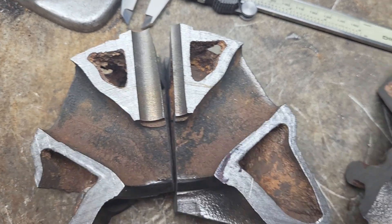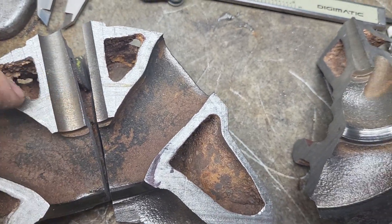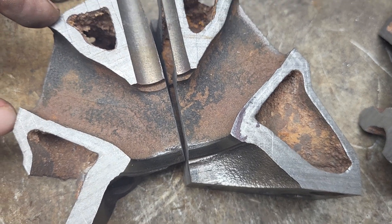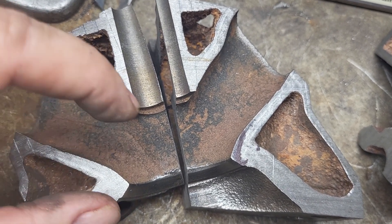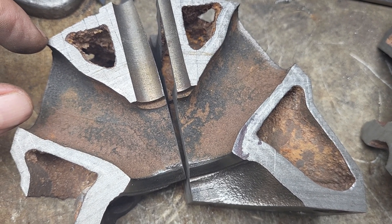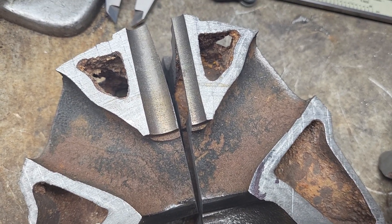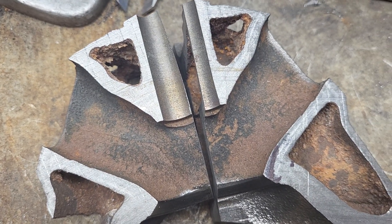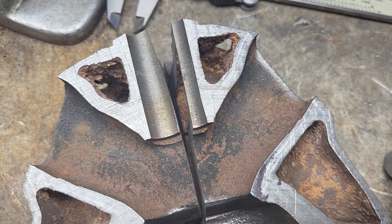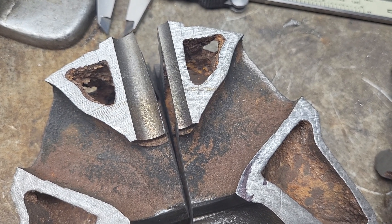Interesting view — mirror images. This one's a little meatier because it moved off the guide a little bit, so we can see more of the port shape. Overall it's a decent shape. I don't think I would have expanded the port up as much — you can see the taper designed into the port. I probably would have just raised the floor and had the whole port coming up. These are 67 heads, these are 920s.